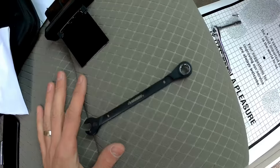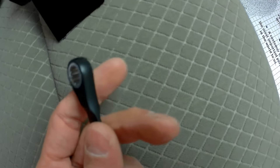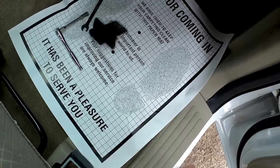The gray connector is connected to the wall, so just pull on it — it's held with two pins and it'll come out. Now you have a nice clear path to the screw. The top screw is out. For the bottom one, it's easier to use a small wrench. You go from the bottom, close the glove box, locate the second screw, and take it out. And now the old resistor is removed.